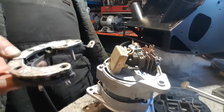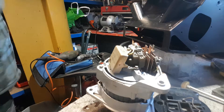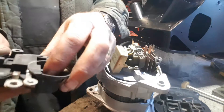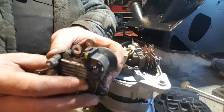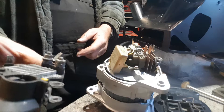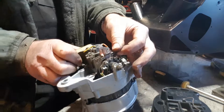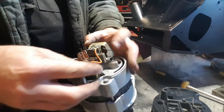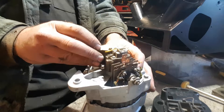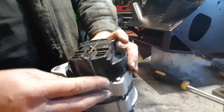I've hung on to this as a spare just in case I ever lose a diode pack on another alternator. On a much newer Range Rover, again, you've got the regulator and the brush components which go on to the slip rings. That would be the middle of the alternator — it would go through there. That's how they work. So, we've done this classic Lucas alternator — we've screwed it back up. We've double-checked that the wires are still located, so we've got the orange and yellow going to the same terminal. It's insulated from the other brush — no way the two brushes are bridged. The earth wire is going back to there. Let's put the cover back on now, and that is it.